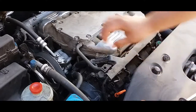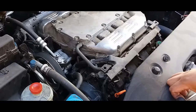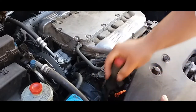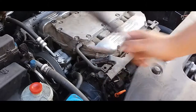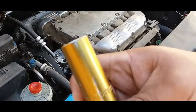The next thing you want to do is loosen up your driveline belt, and by doing that you need to put pressure on the tensioner pulley to loosen up this belt. I believe it's an 18 millimeter socket, so let's go ahead and grab that socket and get started.